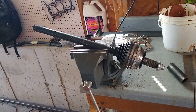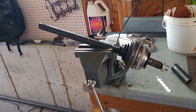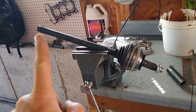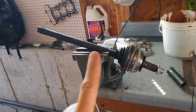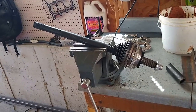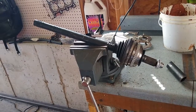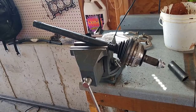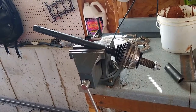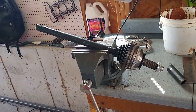I had some ideas in the last video about possibly taking off the joint over here and swapping the axle shaft with the one that's in the car on the other side, but that's not going to work — the other side is smaller. So I'm going to run the hybrid axle, the 03-05 Civic hybrid axle, on the passenger side stock, and then this one I'm going to shorten.